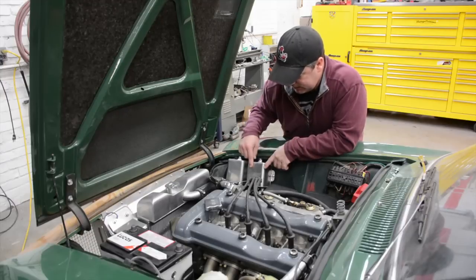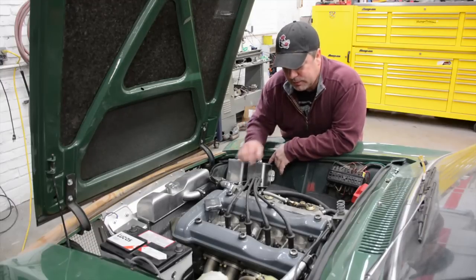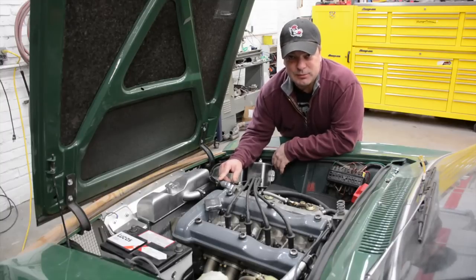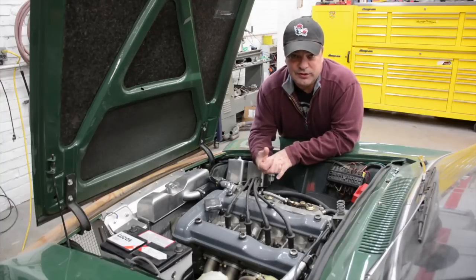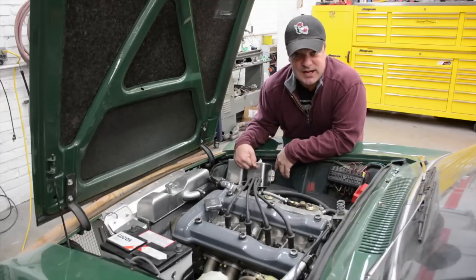And then what is unique about this is you can't see it, but on the backside, I drilled a series of holes because the amount of air vapor that's coming out of this is pretty stout, so you need to be able to allow that air to escape without pressurizing, because that'll cause head gasket issues, you know, all sorts of oil seal issues, so you don't want all that. So this is still very free-flowing. It's going into this canister.